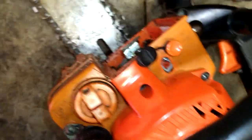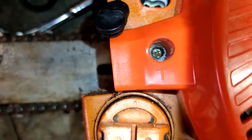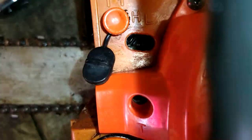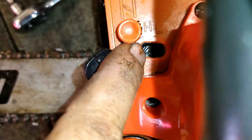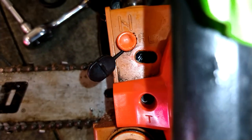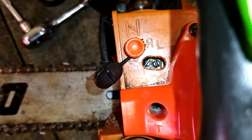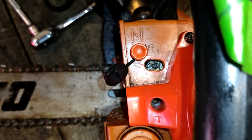It's kind of up in there, so we're just going to try to shake it on out of there. Alright, so you got all the pieces out. There are two flat head adjustment screws in there. The left hand — the H screw — you're going to turn counter-clockwise about a half a turn, and that should get you up and running. Then you fine tune it by going clockwise or counter-clockwise.